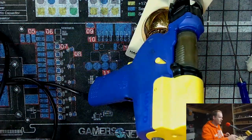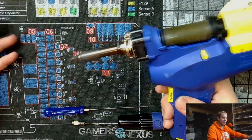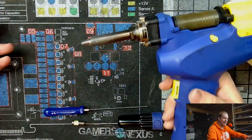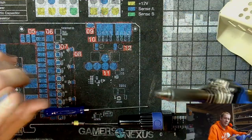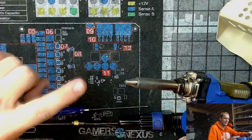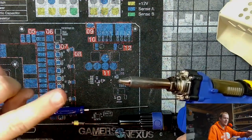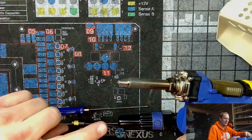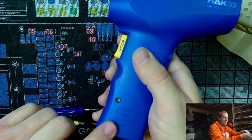We're going to run a vacuum test just to make sure it's working after that servicing. Just hit the vacuum button with it powered on — that's the normal sound it will make when properly working. If you have good hearing, you may also hear a suction noise from the front end. Don't get this anywhere close to you because it is very hot. This end should make almost a hissing sound where you can hear air being sucked in through the entire pump — that means it's fully cleaned and working.